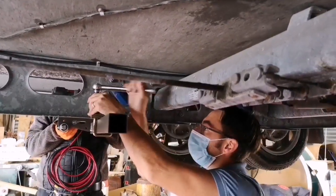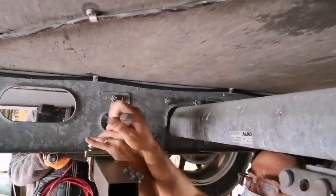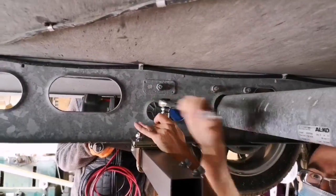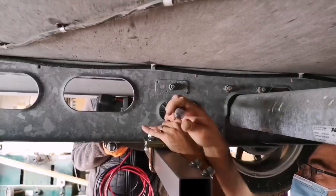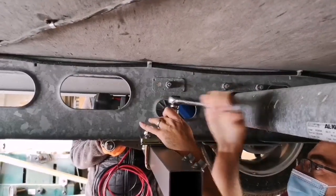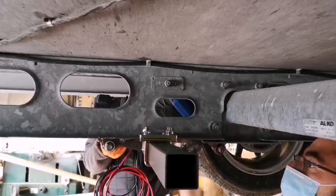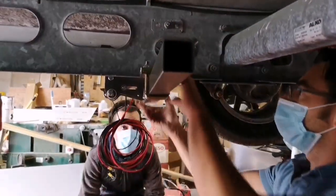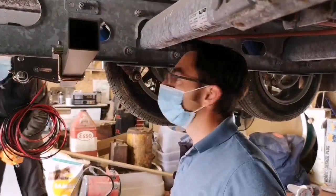But it's literally our 4 bolts on. We're not going to fully tighten them, we're going to make sure that it's loose enough to be able to adjust it, but tight enough where the mover's actually not going to go anywhere. We normally have a little stand to put this on, which makes life a lot easier, and you can do it all on your own, but just in the interest of safety and to make it easier to video. So once that's held in place, we can still manoeuvre it round and adjust that as required.